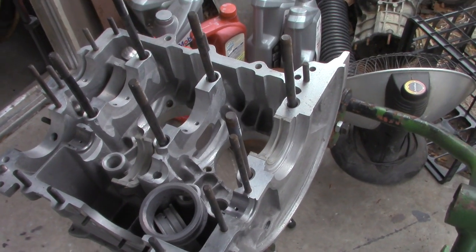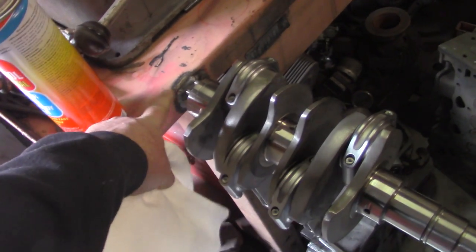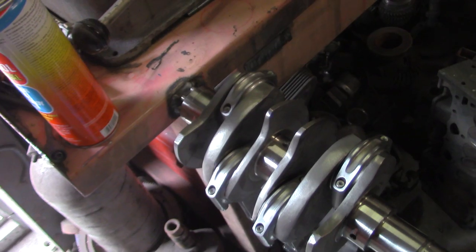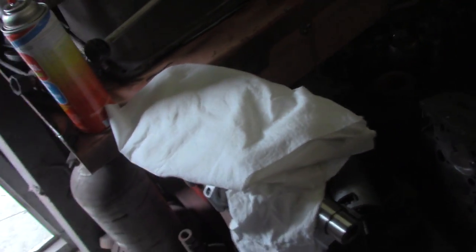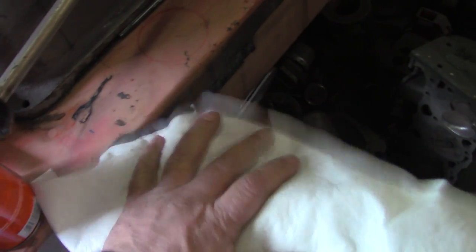So that's what's going on here — a little bearing clearancing for the oil hole. Somebody wanted to know how the heck that crank was on there. There's the crank assembly all torqued up and ready to go. That is the Gene Berg forged gland nut welded to the table. I don't know if I recommend it or not — it's been hanging in there for about six or seven years now, but it's scary sometimes. They make crank holders that actually have a gland nut in them and you can tighten it up and it centers off the dowel pins. This is just a poor man's setup and I wouldn't try this with a regular gland nut.